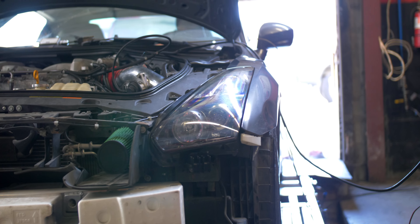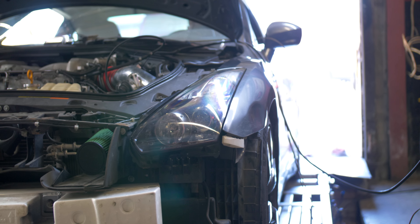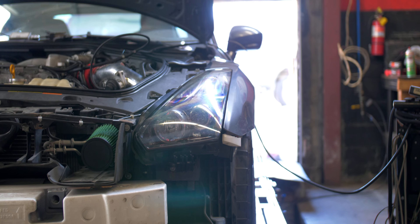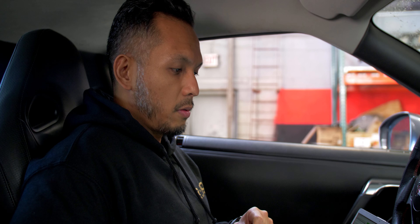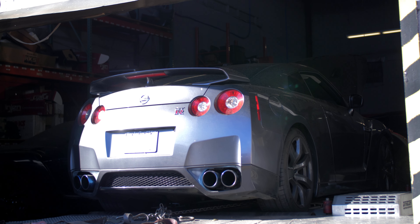So what's going on with this GT-R today? John's GT-R is a very rare 2009, fully stock, that we just did full bolt-ons on, including flex fuel. So we're going from stage 0 to stage 3 plus right on the spot. But for now we're going to focus on tuning 93 octane, that way we have a good baseline for the flex fuel tuning later.